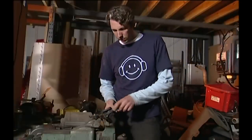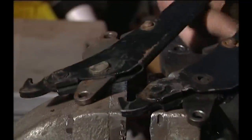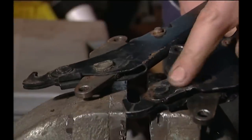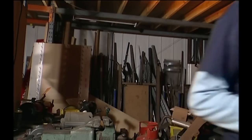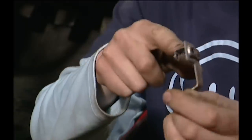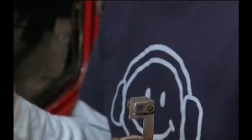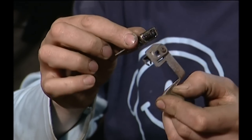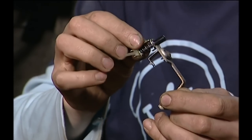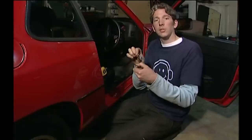This is our new one. Here's the old one, and you can see there's no damage on this side - it's not mangled or mashed, it's just all fine. So I'm going to put that one back in. Now, when I was taking this apart, I noticed that the handbrake light switch just here is actually broken. Very handily, they're the same as a Volkswagen van. So what I have to do now is just replace that, and then when the handbrake's up, a little light on the dashboard will work.